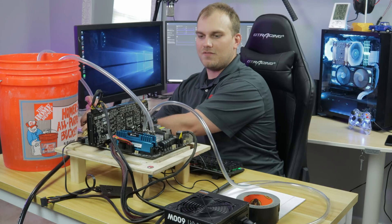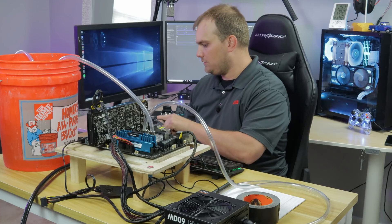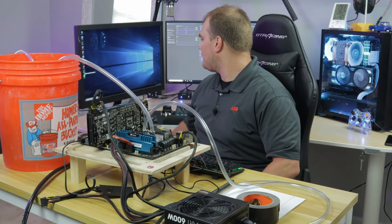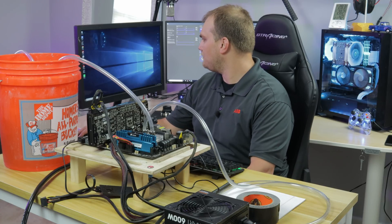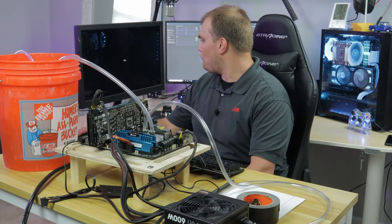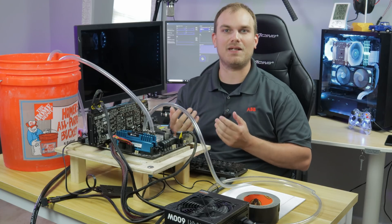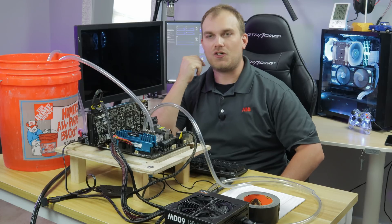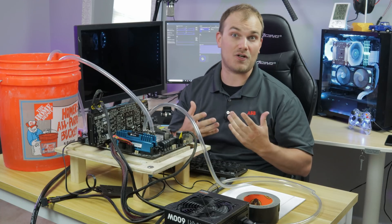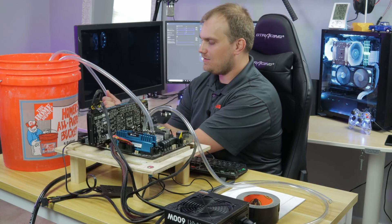It's still on — so there's that, that's good. We are struggling to open AIDA 64 on OBS. As expected, we are booting, but unfortunately we are overheating before we can actually do anything. So the idea now is to underclock it, try to bring the voltage down, bring the heat output down, and see if we can get something somewhat stable. I just set all the BIOS back to default — we'll see if that gets us anywhere.